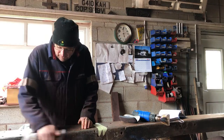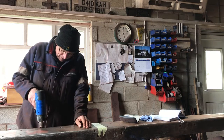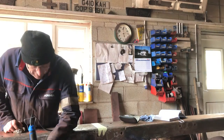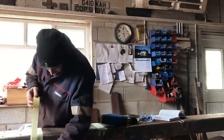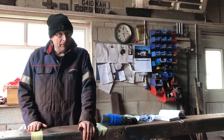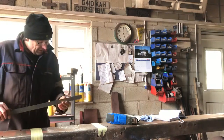This is the critical one — this is where the tape really has to stick because we're going to be dropping the grinder through here. We're going to get a bit of warmth into it and dry some of the crap out. It surprises me how warm those heat guns get — it does make all the difference when you're sticking tape on and expecting it to stay put. We're doing a straight joint, a couple of fillet welds through it, welding both sides. We've got a flitch going in and some of the flitches will also be bolted in — this will never, ever break.